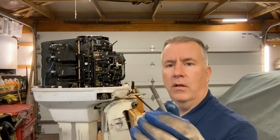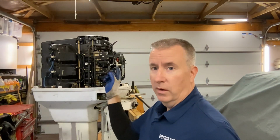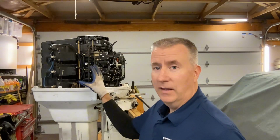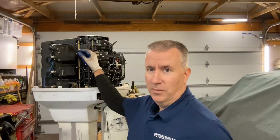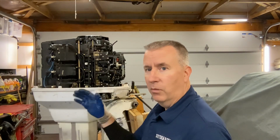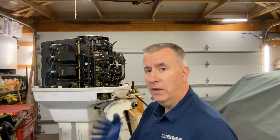See there's oil all over them, which tells me this was either leaking fuel or oil. So we're going to go through this oil injection system as well. Again, most guys are going to eliminate that oil injection system because it was a point of contention with some of these motors. So then this cowling should split in half, and it will be able to access all of the screws, and then thoroughly look through these carbs when we get some pressure in there and make sure there's no leaks.